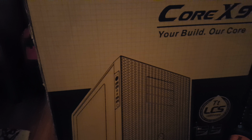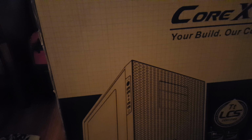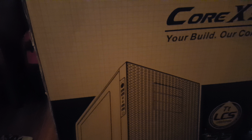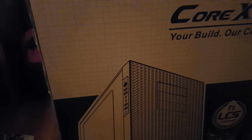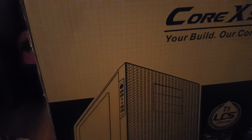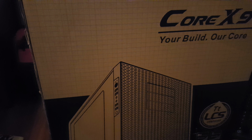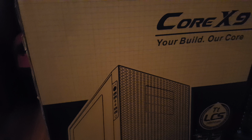Get power supply, drives, and all that kind of stuff in the case, and the motherboard as well. X99 comes with a backplate already installed, so I can go ahead and install the motherboard before doing water block and CPU because I won't have to take that out again. So that's the plan for today. That will be recorded on a different camera probably as we go along in baby steps. And let me give you a quick overview here.